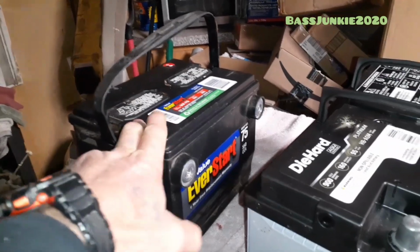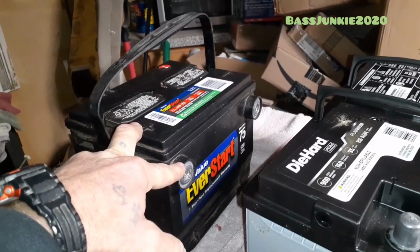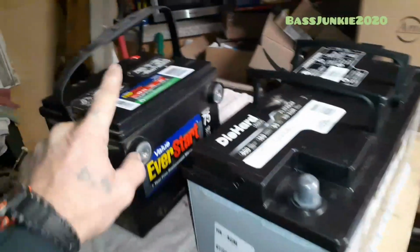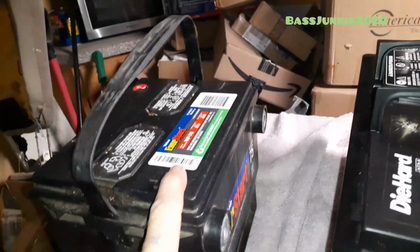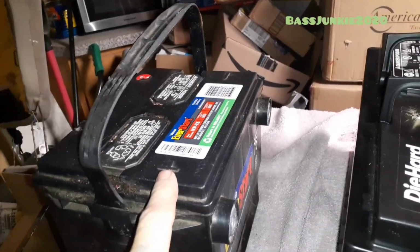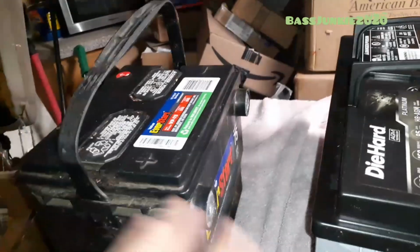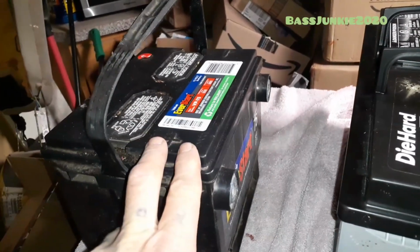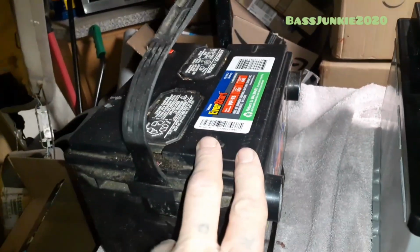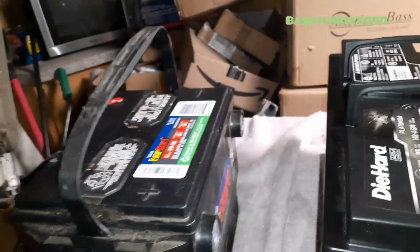Because that other battery, this one right here, this was my problem, why my Smart 3 was going into protect. I can hook the multimeter up to it and it reads 12.5, I think it's down to 12.3. But when I had this one and the other one that I got just like this, the plus one, because this is the original battery that came with the car, the other one I bought, when I had them both together, they were reading 12.5, both of them. So this one was pulling the other one down. But now that they're separate, this one dropped voltage to 12.3, maybe less now. And the other one's 12.6.